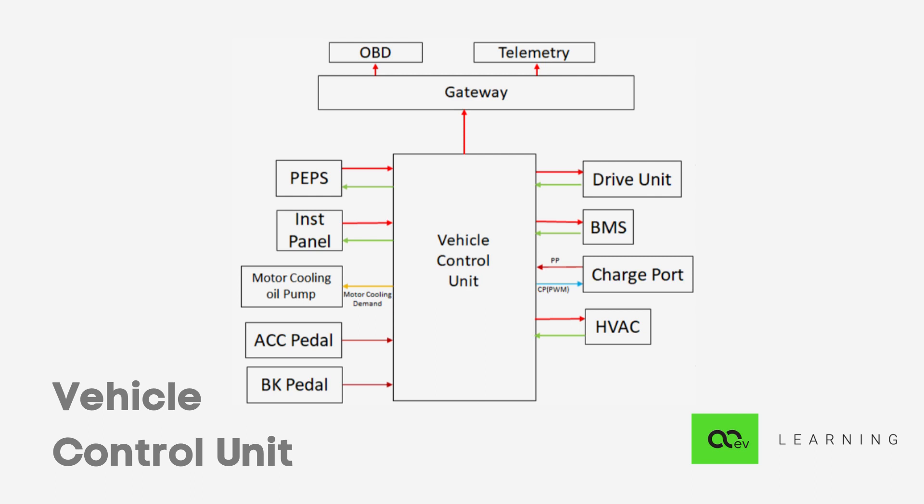OEMs generally use the BMS to generate the charging profile. A big part of the performance of an EV is related to thermal management of the battery and the power electronics. An HVAC ECU is in place to manage all heat transfer taking place in the vehicle, but the logic for thermal management can reside with the VCU. The HVAC ECU does the heavy lifting of communicating with the AC compressor, temperature sensors, and actuating valves. This logic is very diversely implemented in EVs, with approaches ranging from completely decentralized to fairly consolidated ECU functions.